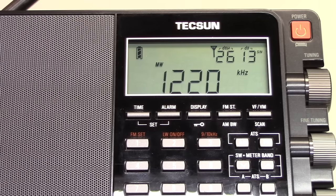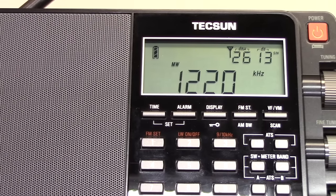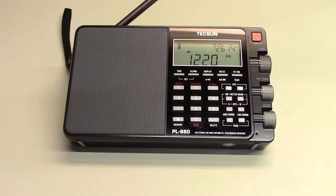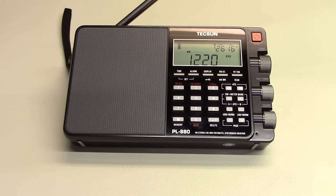This radio is really a pleasure to listen to, practically, because it's not noisy like the C-Crane Skywave was — the speaker just plain sounds better. I found the sensitivity and selectivity to be very good on the AM broadcast band as well. In fact, it holds its own against my C-Crane CC Radio EP, which is a real statement. Furthermore, it couples to a loop antenna quite effectively, which isn't always true, particularly on small radios.